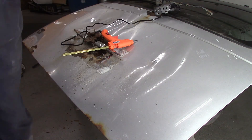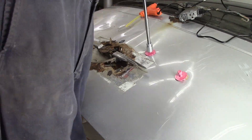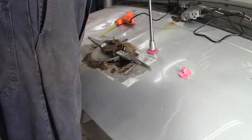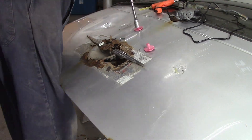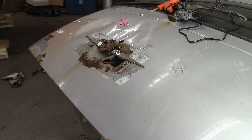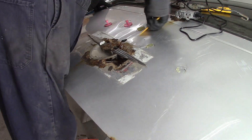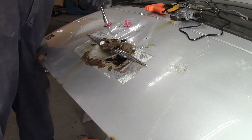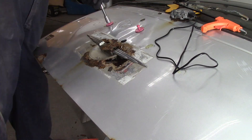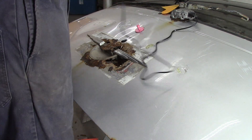What I neglected to do is follow advice I've been told time and time again: when you're pulling a dent, the first part that goes into the panel needs to be the last part that comes out. I always forget that. I always go to the deepest part of the dent and try to pull that out. What you want to do is start from the outsides — the last stuff that went in — and start pulling that out. It's a much smarter way to do it.